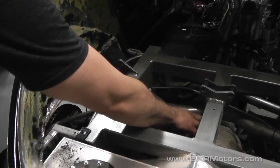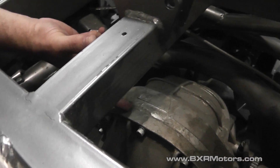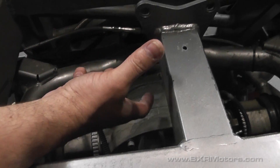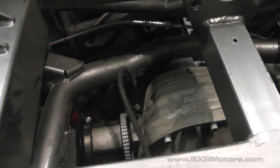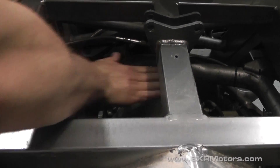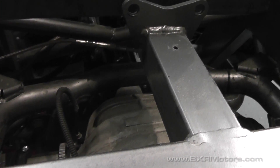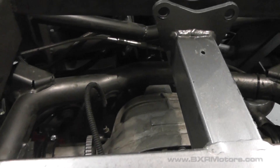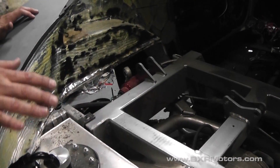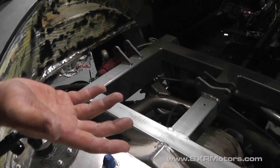You can see the rear end down in this area, and from the top of the rear end to the top of this bar is the space we're talking about. We'll be taking out a good five to six inches of depth and making the bottom of the trunk right above the rear end and suspension pivot points. That's going to lower all our shocks and suspension further, decreasing the center of gravity back here and cleaning up a lot of extra weight - we'll probably save another 50 to 60 pounds in metal alone.